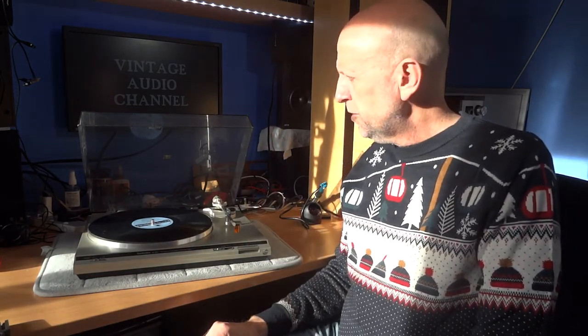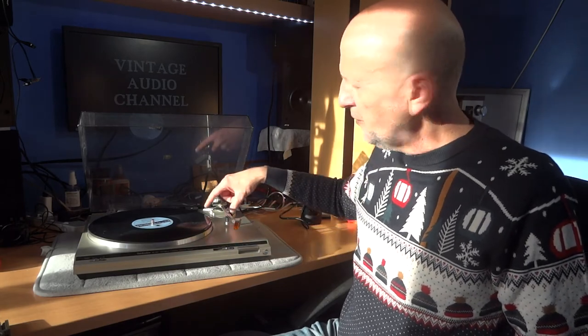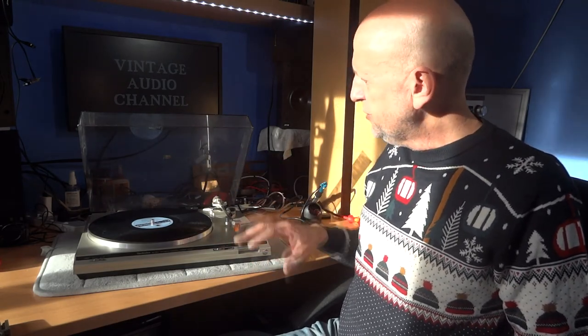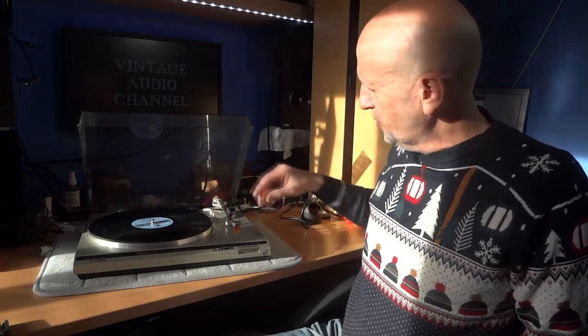Value-wise I'd personally prefer a second hand one — just make sure it's all working properly and feels right. Another thing to check on a second hand turntable is the cueing lever dampening fluid — this little mechanism that brings the arm up and down has fluid in it, and like the grease, that fluid can seize up. Make sure it goes down nice and smoothly and consistently without you having to help it. Some you can top up the fluid, but it can be a nightmare. Also bear in mind ball bearing wear and motor wear. Make sure you don't overpay — the last thing you want is to pay top money, then spend more on parts and end up with it costing twice as much.